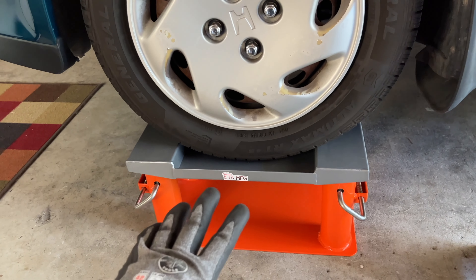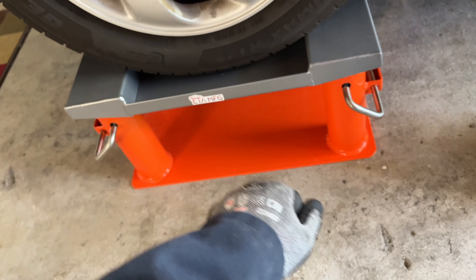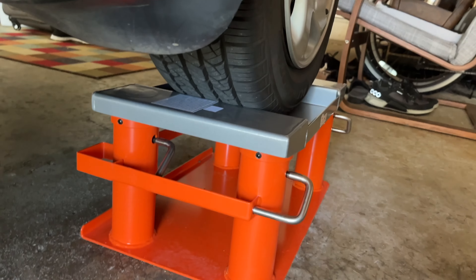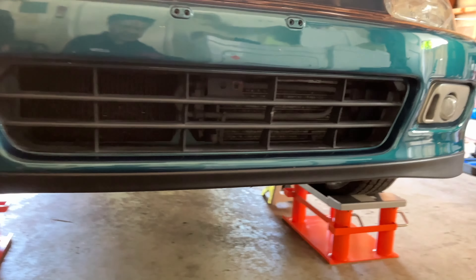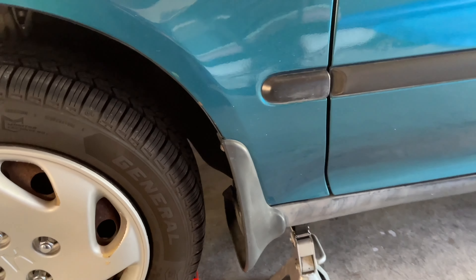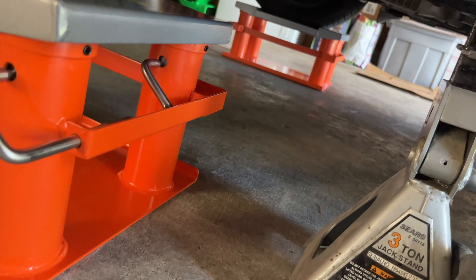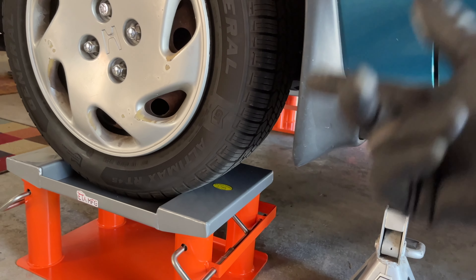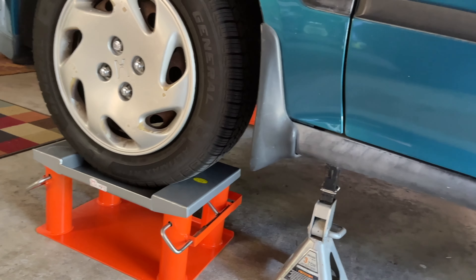So as you can see here, I have the car supported by the MyLift stand. The hooks are engaged so that when I move it up further, the hooks will latch on. I have the other side lifted and supported by the MyLift stand, and as you can see, the wheel is dead center to the stand. From here I can jack up the stand further. This is plenty high for an oil change. And if you want additional security and peace of mind, you can also have your jack stand just under the pinch weld — it doesn't need to be supported by it, but if the car shifts, your jack stands will support it. You want them on both sides, so this is pretty safe.